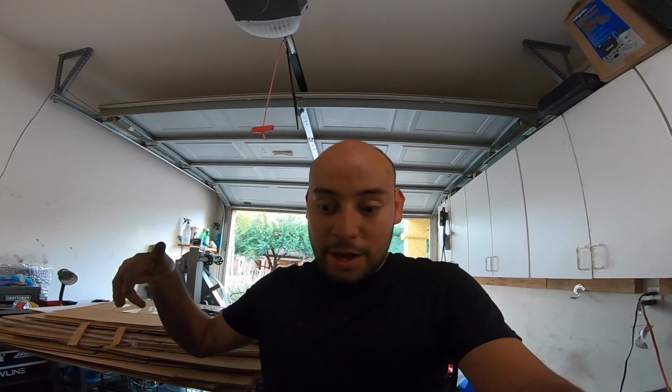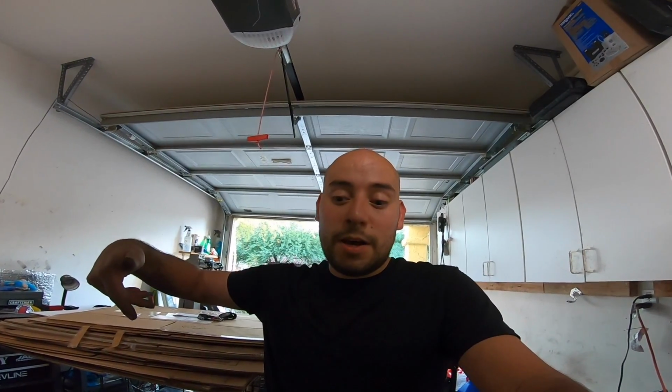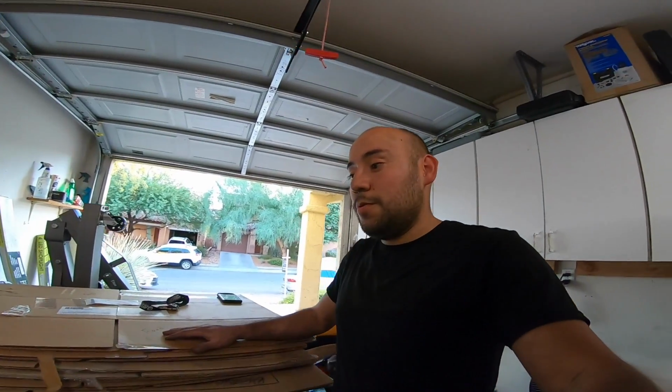So hopefully you guys have a good idea on how to do it with that video. The intake manifold bolts, the bracket in the back, the two brackets in the front, and remove the intake, and that's it. The coil, but to remove the spark plugs in the back, you'll need a shorter extension to get back there. But other than that, it's the same as the front. Not that bad.